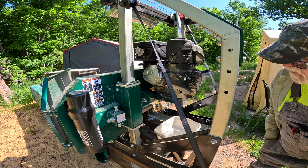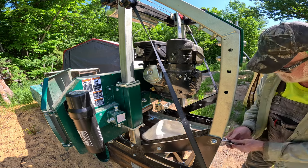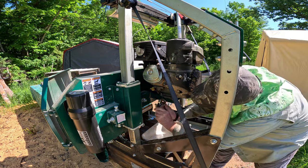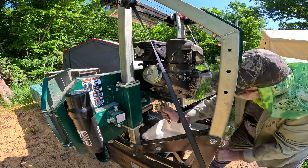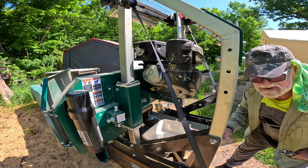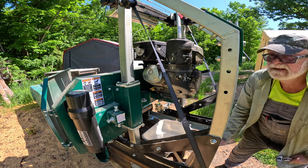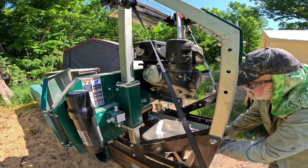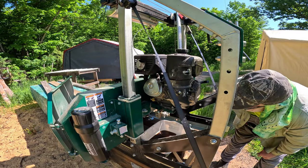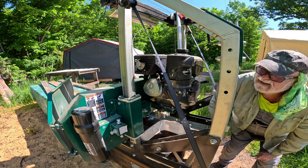We've been running more than long enough. Let's sit the oil pan on it. According to the manual, we want 10W-30 oil in it, and it holds 1.1 liters. It's nice to know the amount so you can measure it out and pour it in — if you've got a whole bunch left over, you know something's wrong. Let's just let that drain. As you can see, the oil does not look dirty at all, but it's time to change it. The oil not looking really dirty is a good sign.